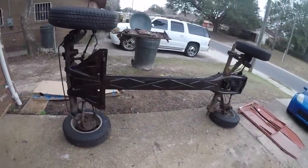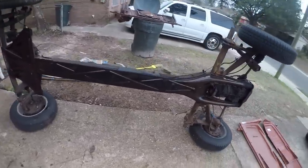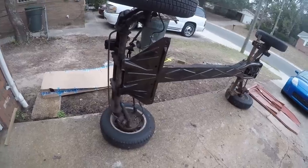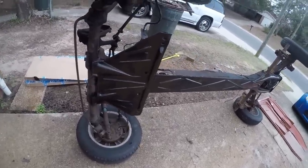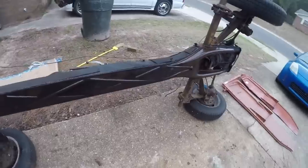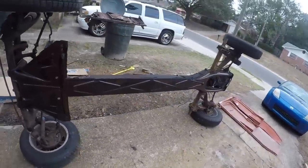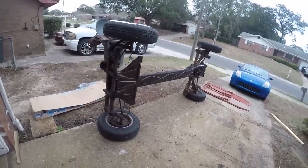You can see that just in the time it took me to flip the floor pan over, how fast the acid has reacted with the rust — it turned it very, very black, and it's still currently reacting. Phosphoric acid is interesting because when it reacts with rust, the rust becomes ferric phosphate, if I'm not mistaken, which is inert. Water will not oxidize it unless you chip through it down to the bare metal underneath. But it will not rust again — the only thing that will eat at it again will be phosphoric acid, and it doesn't appear in the environment in a large enough quantity to cause more damage. The byproduct of the process is water, and a lot of the dampness you're seeing there is actually the water still evaporating from it.